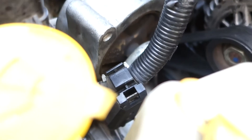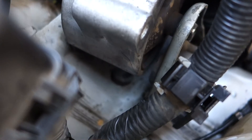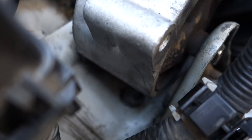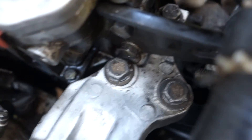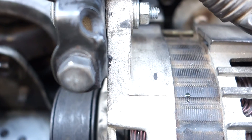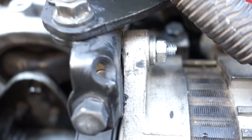When you put this new motor mount back in, go ahead and put the bolt that goes through it in first. There's a little pry spot down there - pry it forward and you can match these up. Then tighten up your alternator. I have a custom Harbor Freight bolt going through here because the thread stripped out. It was just a bolt with threads in the housing so I came up with my own solution - it's working good so far.